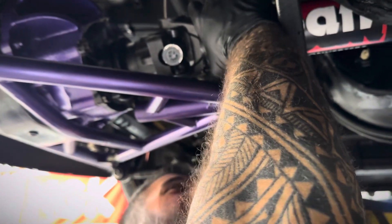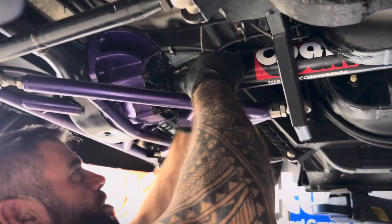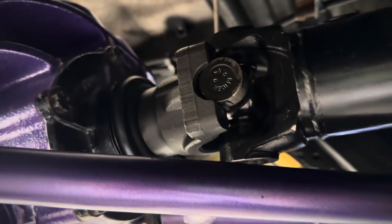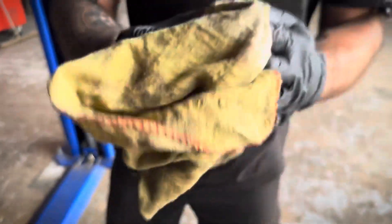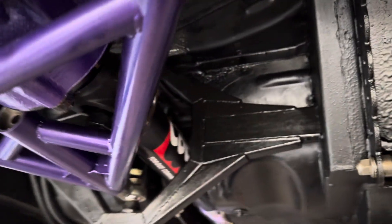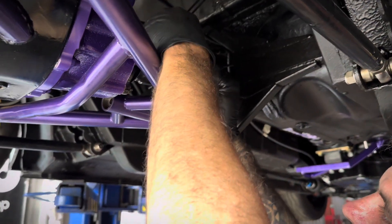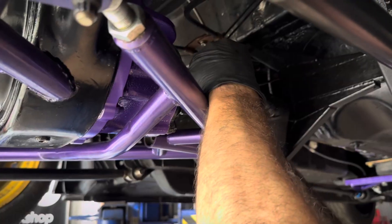Oh, she slid back in. That's why we have to go to the gym. Right, CNC cups going on the other side - pop them on, make sure they're clean so no crap gets between the bearings. That one wasn't seating properly, but oh there we go - like a glove. Pop on the washer, pop on the spring washer, then the funky imperial nut from over the pond, because these parts are from the States - we don't do anything like this here.